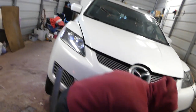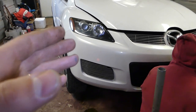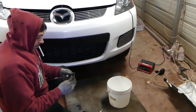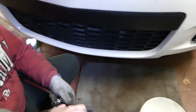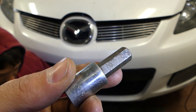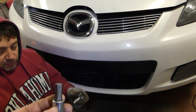You will need to jack the car up a little bit on one side. It's even better if you have it leveled, but if you can crawl underneath it, that will be great. Next, you will need an allen wrench — specifically a 10mm. Do not use a smaller one because you are going to mess up your drain plug.